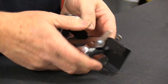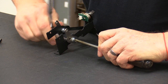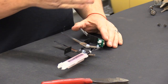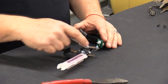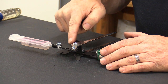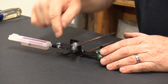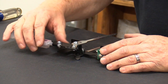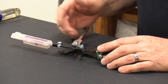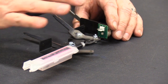Tighten it up so it's got tension but you can still move it. Now I've already assembled the mode control — this is the one that controls all your temperature stuff, changing from AC to defrost to heat. I'm going to show you how to assemble these on the other one. On the mode control, there's a bracket that sticks up in the air as an independent piece on the backside. The mode control actually goes in port three for controlling the system. You'll notice that it does bend these shafts — that's okay, that's part of the deal. It only goes so far, so you're not going to bend it over too much. That one is set up and operating the way it should.